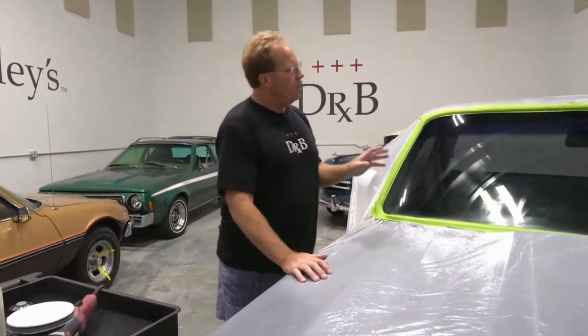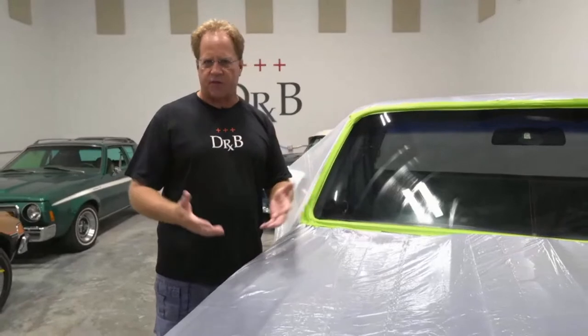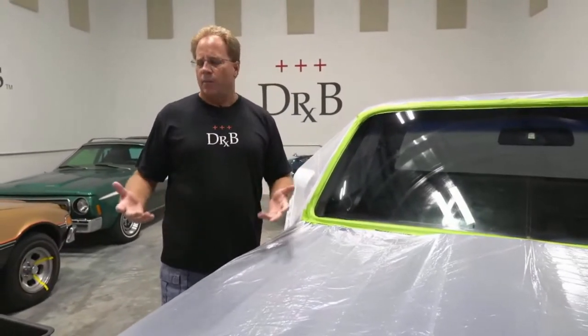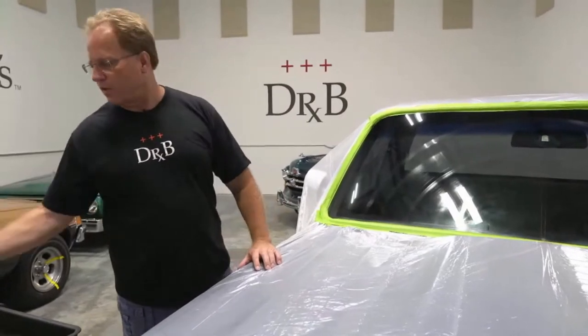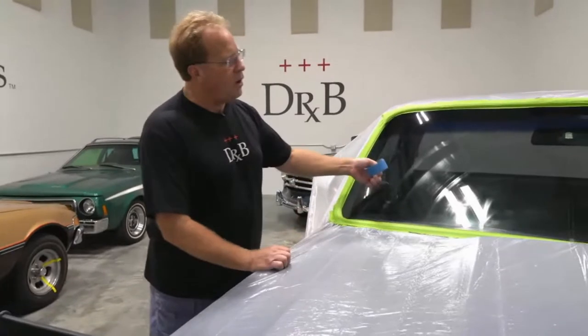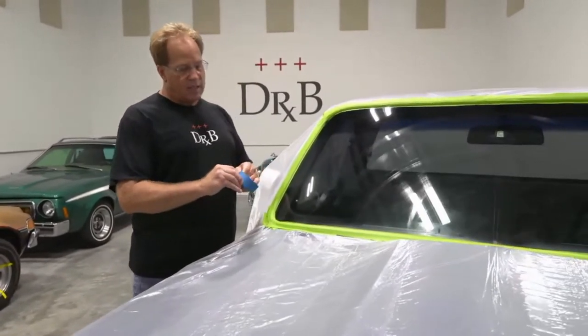In the real world, glass, you gotta keep in mind, it's not gonna correct like paint. I'm gonna imagine a lot of people watching this video now and into the future work on a lot of paint, do a lot of paint correction. Paint, if you gotta pull scratches out of it, it works pretty good, pretty fast. But glass is hard, so it's not gonna buff like paint or even gel coat. So it's gonna take you longer.